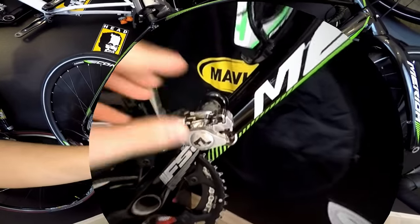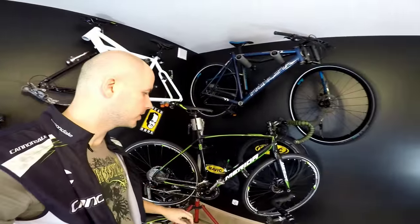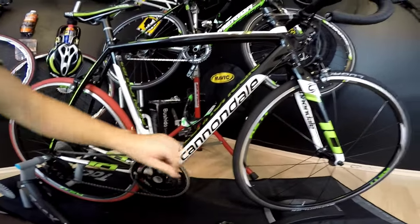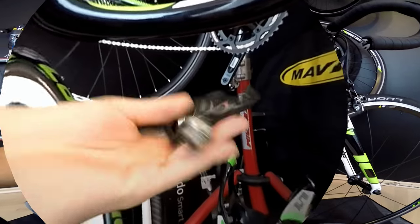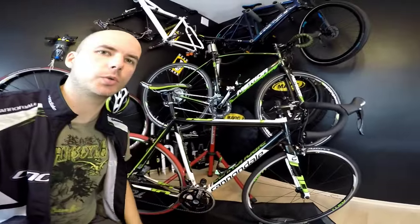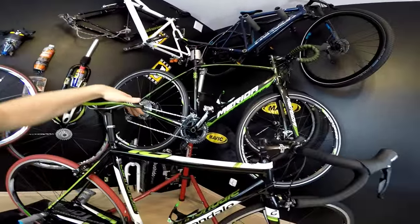Then the pedals — these are regular mountain bike clipless pedals. We use something that works fine for mud and sand, so this Shimano SPD type or Crank Brothers Egg Beaters work great. Since I'm using the same MTB pedals on my road bike there's no difference here, but a road bike would typically have one-sided pedals where you can only clip in from one side, which wouldn't be good for mud and terrain. The shoes would also be completely different — road shoes wouldn't allow you to walk or run as you need to during cyclocross racing.